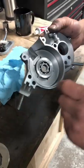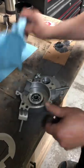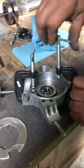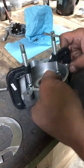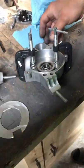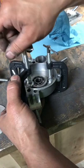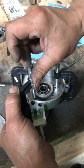I'm pretty excited to run this engine actually. That was fairly easy so far. Now I'm just installing some C-clamps on the plate — not putting a lot of pressure on it, just enough to hold it in place while it dries. I'm going to fill this up later; I'm just doing this as a demonstration right now. Just a little bit of pressure to get that plate sitting down — nothing too much. You can use three or four C-clamps, whatever you can fit in here.